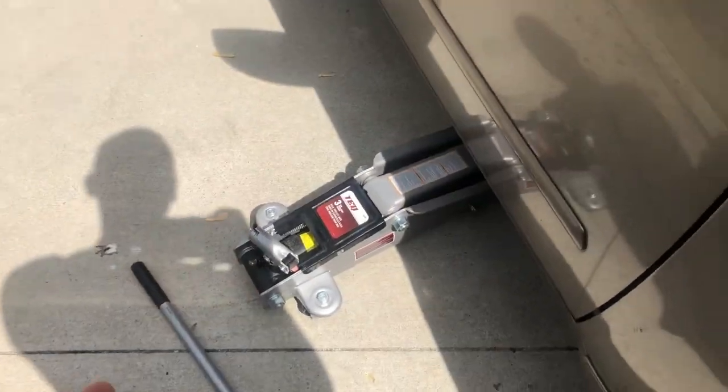And ultimately, you need a jack or something to lift the car up. You must identify something that can be hard. We identify a piece of metal under here — it's like a beam for the lift to go on, so it doesn't damage the frame or damage the side panel.